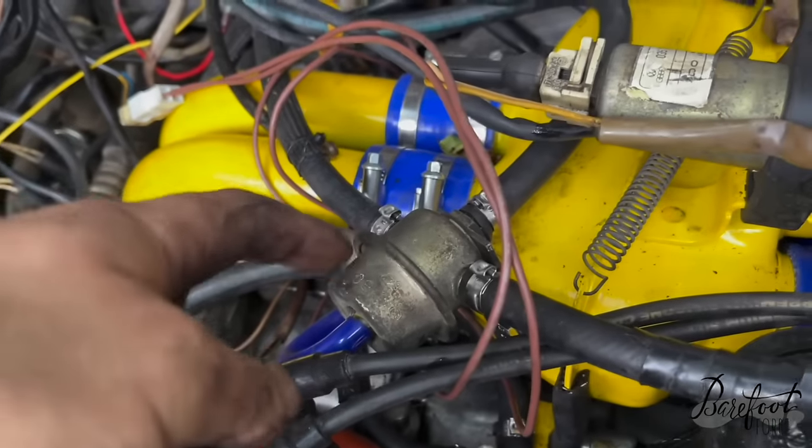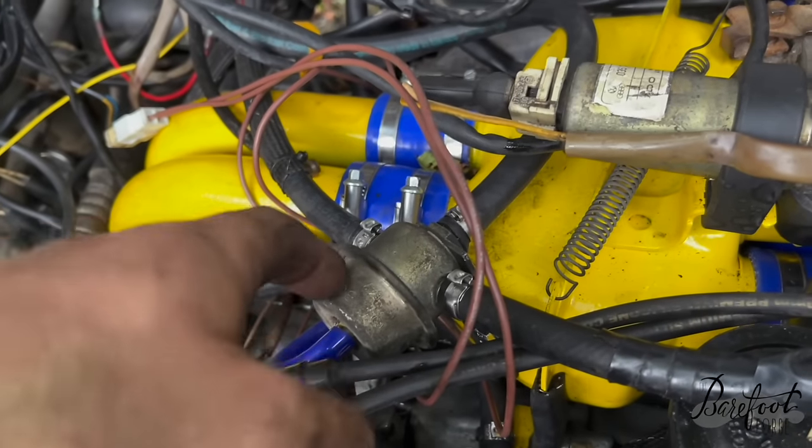Why? What's requiring so much gas to get it going and then it's running like absolute horseshit? Temp 2? Could be temp 2. Let's replace temp 2. We're on a different fuel pressure regulator. That kind of makes some sense. Let's see if that fixes it. Still got a hunting idle. Absolute garbage of everything.